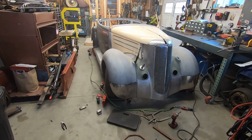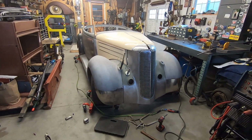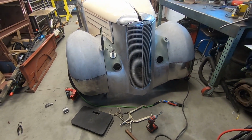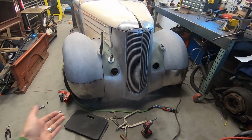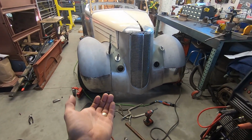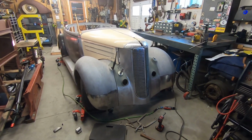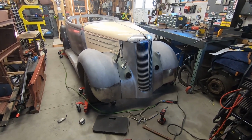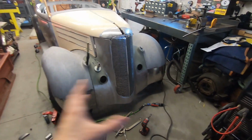So to get into that, then if I'm taking that off, the front centerpiece is going to come off with the grill, and I'll most definitely roll the bottom edge of the front over like I've done with the fender extensions. So everything will kind of have that factory J edge to it. So that's what I'm going to do now. I'm going to be taking these fenders off and fixing them, finishing them so they look like the center section, and then that will be all finished.